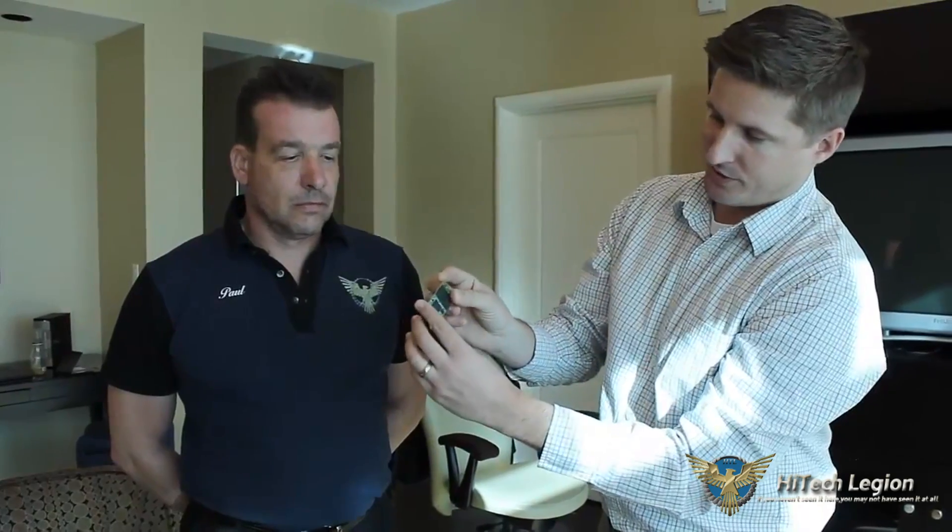We were the first SSD company on the retail market with a 480GB mSATA. That was a mezzanine board design with a little more height. This is a single board design. It uses the new Sandforce B04 controller, 128 gigabit Micron die, eight packages — so this is a terabit package — for 512 gigabytes raw capacity of flash, 480GB with over-provisioning. You'll see this hitting the shelves very soon under our Atlas Deluxe 480GB line. Compared to our other one, this helps keep the heat down and has a lower profile with a little lower power as well.